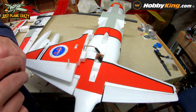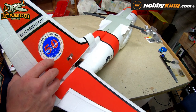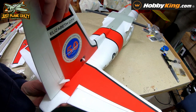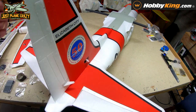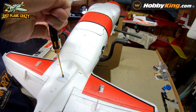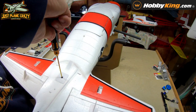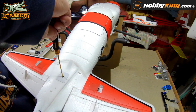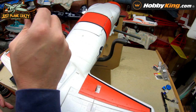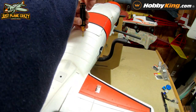Put some tape on all those connections, push them down in there, and make sure you don't pinch your rudder wire — it drops into those two big lugs right there. Now let's put this on a stand and install the screws from underneath. We're going to install the three-millimeter rudder screws. Once it's all screwed together with these plastic pieces, that elevator and horizontal stab shouldn't be able to come out of this plane at all.